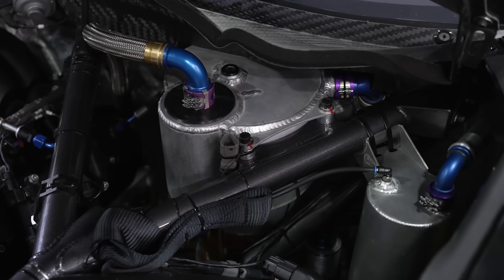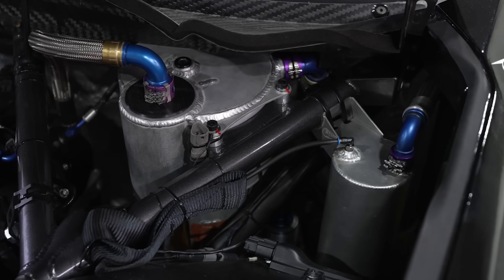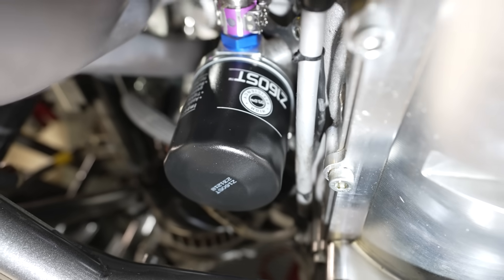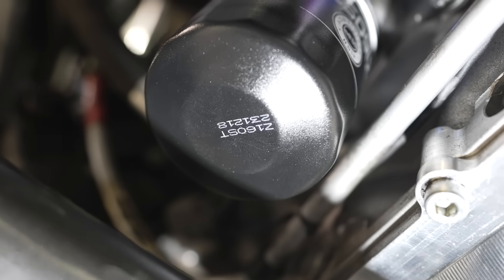The filtration system is a little bit different. With all of the oil that returns from the sump back into the oil tank there is what we call a rock filter. We check that every night — it's going to show us if there's any failures of any components inside the engine. Subsequent to that it also runs a normal spin-on Ryco filter, the same as your road car or similar to your road car.